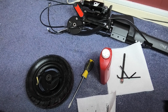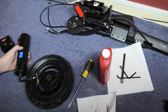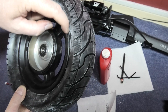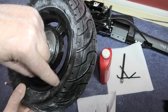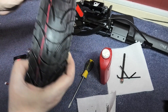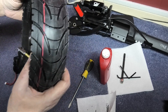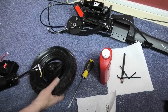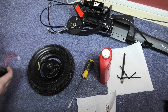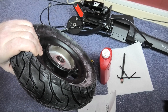Unless it's an M365 — then you've got no bloody chance. When it's half inflated, I don't know if you can see, but there's a line on the tyre which is the part that needs to sit on the bead. Just make sure that's visible all the way around and then you know it's actually seated properly, because otherwise it goes off-centre, like the back one's gone. Same as the back one — I put 40 psi in just to make damn sure that it holds.